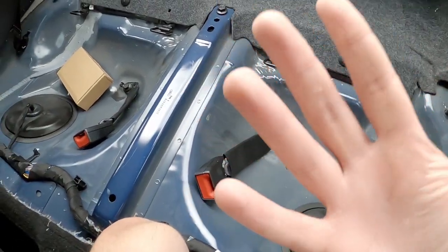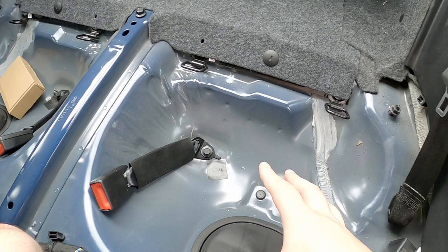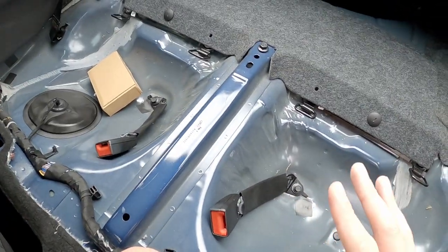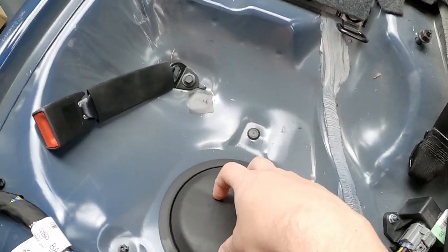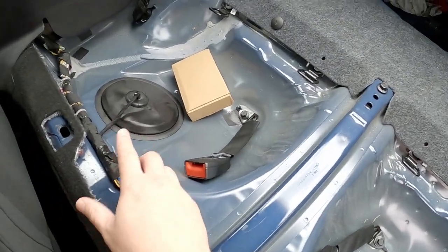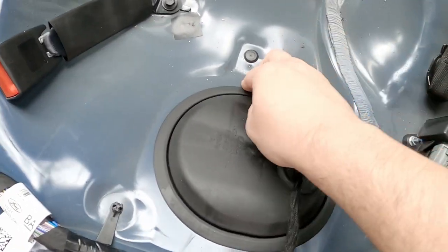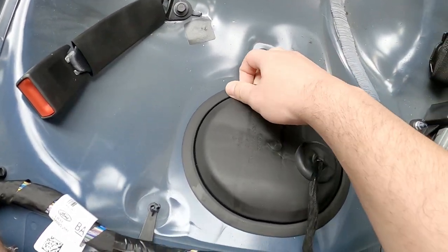This has definitely got to be one of my favorite things about modern cars. I don't know why it took auto manufacturers so long to figure this out, but I'm glad they did — making the fuel pump and sending unit serviceable without dropping the tank. Both of these here are for doing that. I think that one is for the sending unit, and this one's for the fuel pump, which is more or less where I'm going to be going.